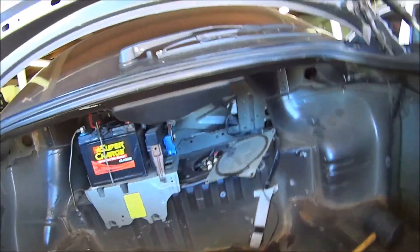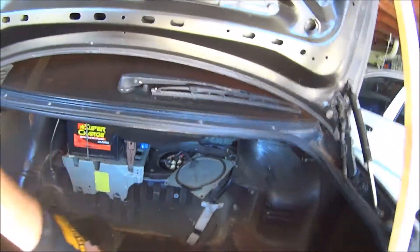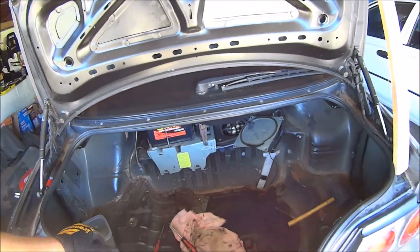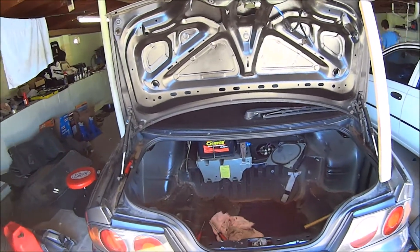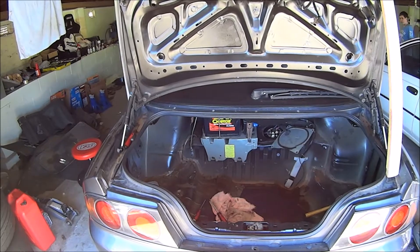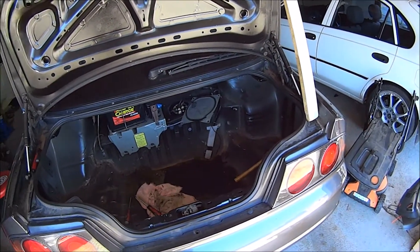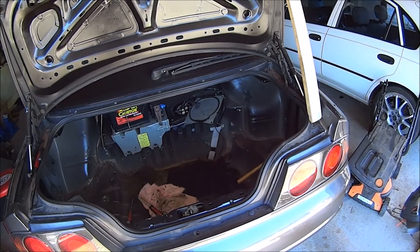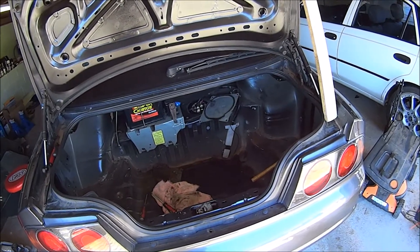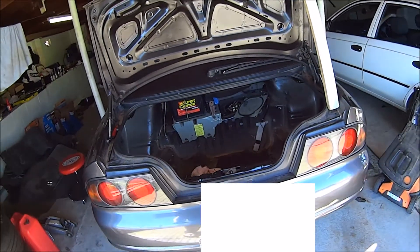Fitting that stuff wouldn't help, and being able to get in through the back seat — it's sort of all angled down that way anyway. The job is done. The fuel pump is a Walbro GSS342, which is a 255 litre per hour pump, good for a hypothetical 500 horsepower. And in theory it's okay for ethanol, so she's ready for ethanol.